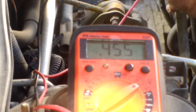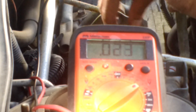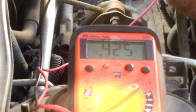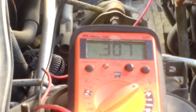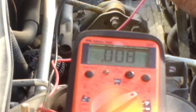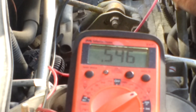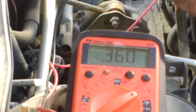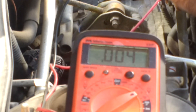There we have it — I make that 0.455 DC volts. What I do now is rotate the throttle position sensor just a little bit, tilting it towards the front of the motor. A little bit too much — now reading 0.546. Getting closer — now 0.503. I don't know if I can get any closer than that.